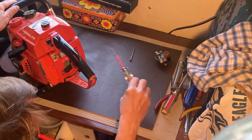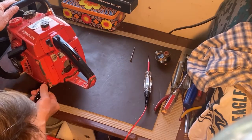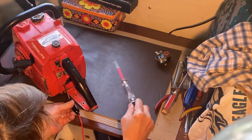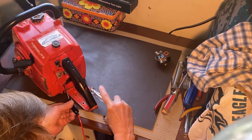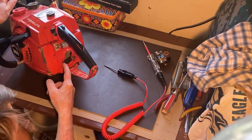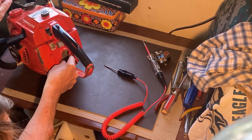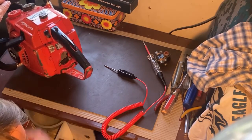So if you were to do this test exactly the way I just did it, and you get a flashing light, and then you probe directly to the left contact, like with my nail, if I probe that left contact to the right contact and I don't get an indication of a spark or a light there, then that would make it really suspicious that perhaps you have a grounding problem on that left-hand contact, because when you bypass it, it flashes and when you go directly to the two contacts, it doesn't flash. So that could be a way of troubleshooting a ground issue with that left contact.